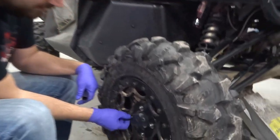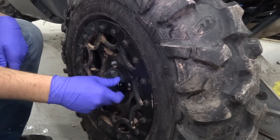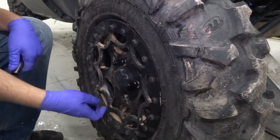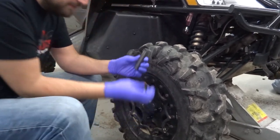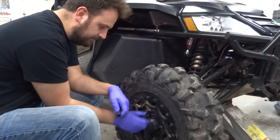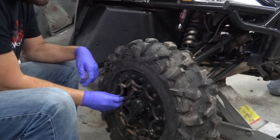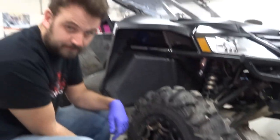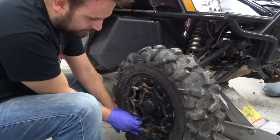You can see these new studs are just sticking out super far - you can actually set your lug nuts on there without thinking you're cross-threading them. They give you these nice either black or chrome lug nuts. I went with black because my whole machine is black. They also give you this little spline adapter that you're going to have to carry around with you. Make sure you pre-thread things on before hitting them with a gun, then use this little adapter. I think I'm going to go with 100 foot-pound torque - the stock ones are 10mm and call for 80 foot-pounds.